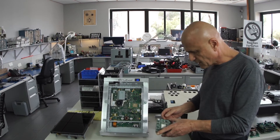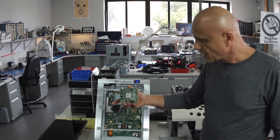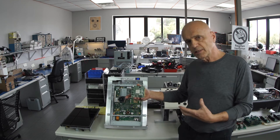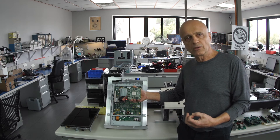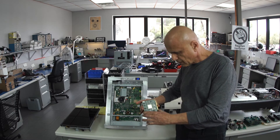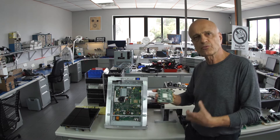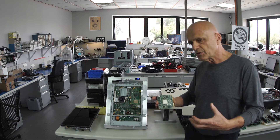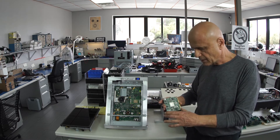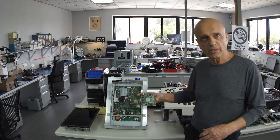The Tegra board has a flash chip on it, which was originally sized at only 8GB. With all of the updates and the traffic that this chip is being hit with, they are now beginning to fail. What we do here is replace this chip with one that's twice as large. We also improve the firmware in that we send a lot of the senseless, repetitive traffic to RAM so it doesn't overload this chip. In theory, we're thinking this chip is going to last a lot longer — maybe even forever — in a Tesla Model S.